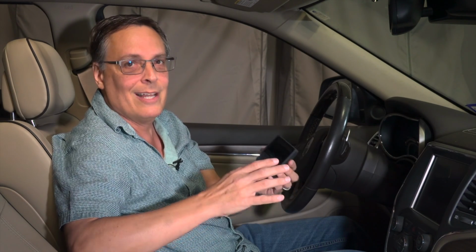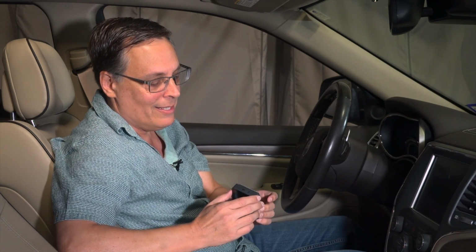So that's kind of a quasi parking mode. That means you've got 15 minutes of it just recording regular footage. It's not really parking mode footage, but it's footage. So you have it. But there's a couple of problems with the way this is implemented. The first problem is that, say somebody runs into your car, okay, motion detection will trigger the camera to then boot back up and start recording again.